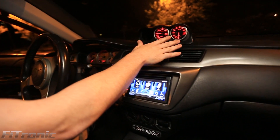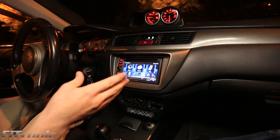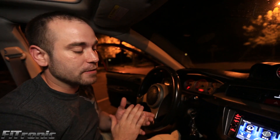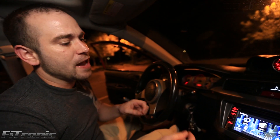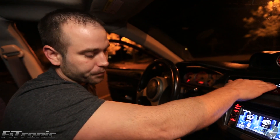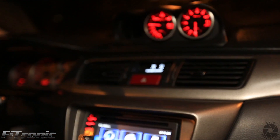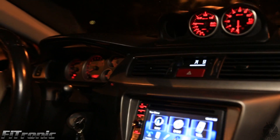So you don't actually need to have multiple gauges. One of the great features of the system is that we can add any type of device to it. If you want oil pressure or temperature, anything like that, we can take that sending unit and wire it into the controller itself and then have that displayed up here. This is one of those great things where you can save money, save weight, and it's a very awesome and very reliable setup.